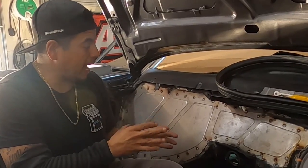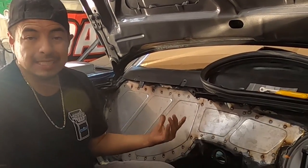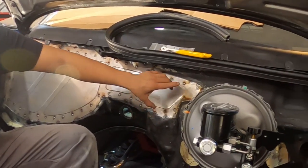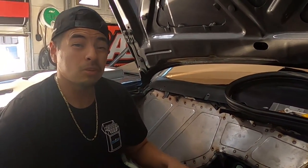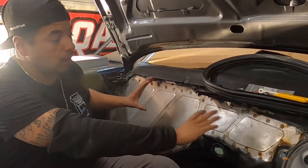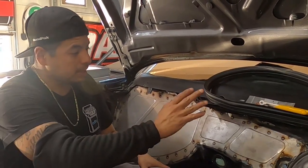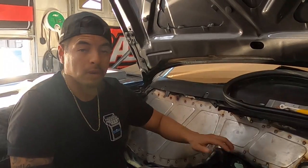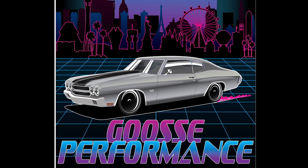We got pretty much everything tacked in. Don't get crazy with the welder — just tack, tack, tack, because it's 18-gauge sheet metal and you'll burn right through it. Do small little tacks to round out the edge so when the body guy comes in it's easier for him — less bondo needed. After the firewall plate is in, body work it, sand it down, hit it with self-etching primer, and your choice of paint. Hope this works out for you guys — stay wrenching!